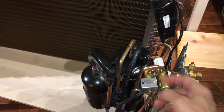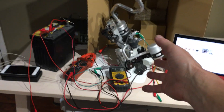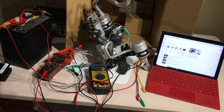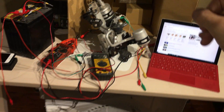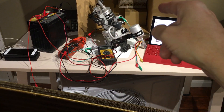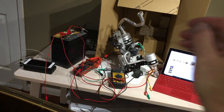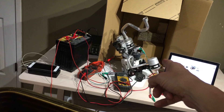One solenoid to operate it — Denso actually uses multiple, I think there's two more solenoids — or one sensor driving an expansion valve, like an electric expansion valve on the system, which is right here. This is the electric expansion valve right here. Very cheap, easy, inexpensive, simple item. They had to make it really expensive and complicated.